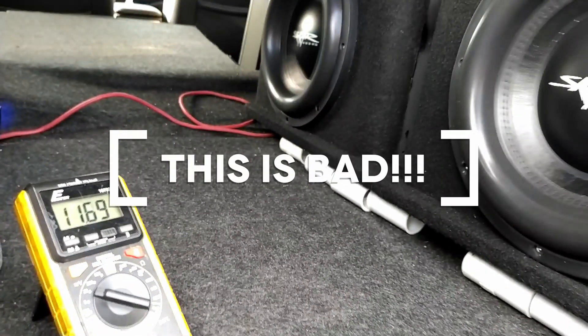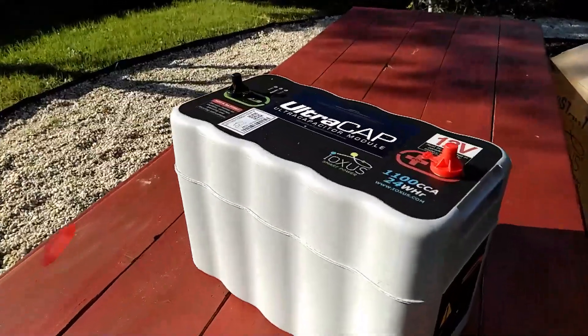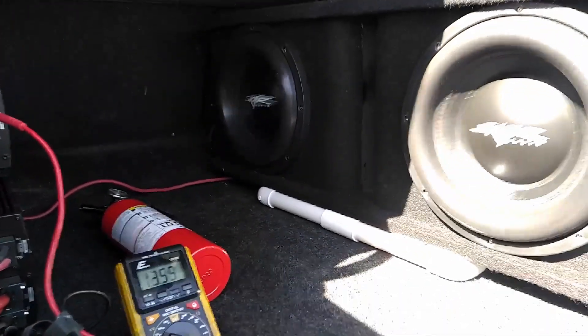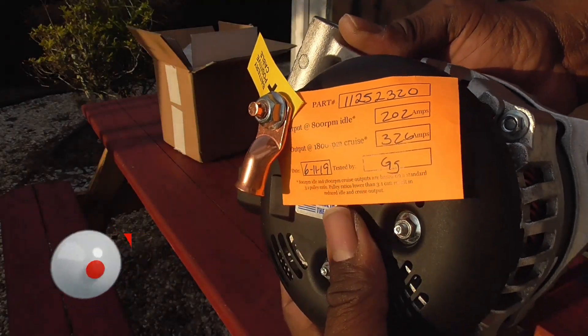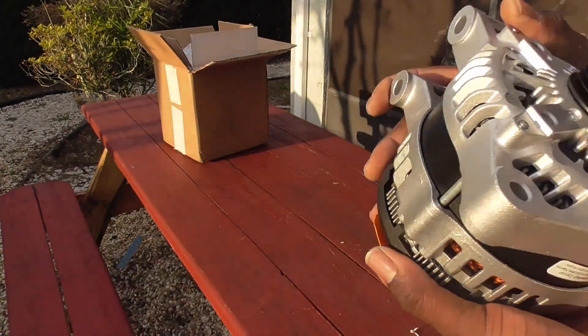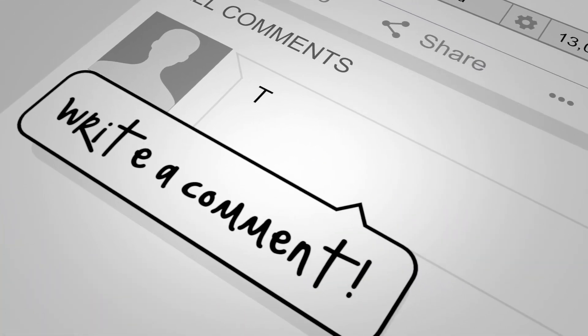Alright guys, as you can all see, I am not out of the woods just yet. Simply adding an ultra capacitor did not completely solve my problems. Yes, it recovers a lot faster and yes, it stays well within voltage the majority of the time. However, my voltage still dips into unwanted territories and fluctuates way too much for my liking. This is a clear sign of the stock alternator not being able to keep up with the demands, and therefore it relies heavily on the capacitor and battery to handle the massive drops. Please stay tuned for the next video to see if installing a 320-amp alternator from Mechman gives me the stable voltage I desire. Thanks for visiting the channel to help you simplify car audio — it's the Budget Bass Head, and I am out.